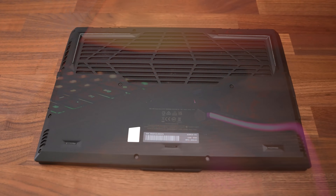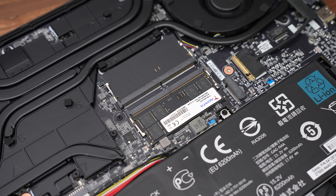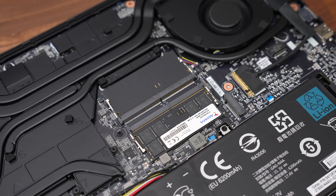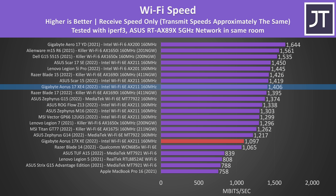There are 14 TR6 screws to remove to get inside, and the 6 towards the front are shorter than the rest. Once the screws are out, it was very easy to pry the bottom panel off using pry tools starting at the back hinge. Inside we've got the battery down the front, two M.2 storage slots, two memory slots towards the middle, and a Wi-Fi 6E card to the left. Intel 12th gen supports either DDR4 or DDR5 memory, and while the non-X Aorus 17 is available with either option, this higher tier 17X only seems available with newer DDR5 memory. Wi-Fi performance wasn't very good for some reason, considering it's got the same Wi-Fi card as the non-X and presumably the same antenna design, even after installing the latest drivers from Intel.